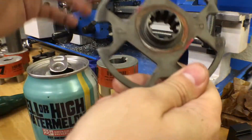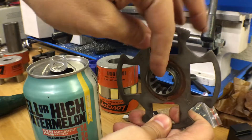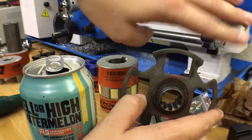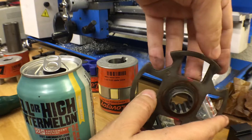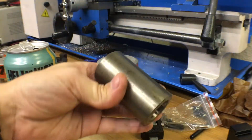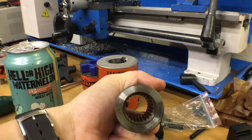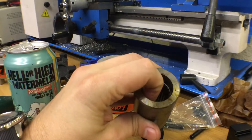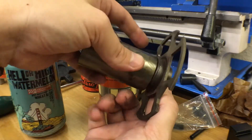The thing I was after in drilling out the clutch is this piece here — specifically the sprocket and the coupling piece that originally took the shaft out of the transmission and moved it to a friction plate to transmit the torque and horsepower from the gas motor into the transmission. Now all I've got to do is take this coupler, which is beautifully and perfectly machined for the Siemens electric motor I'm using, except it mates on this side and my transmission doesn't have that same splined piece — so I've got to adapt them.